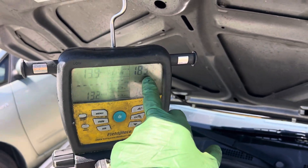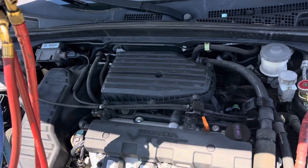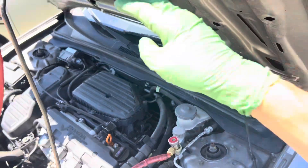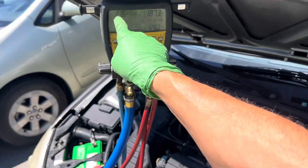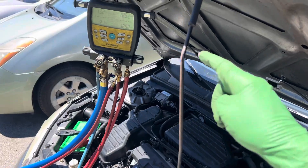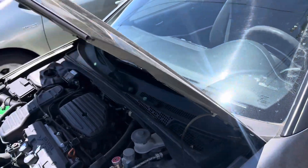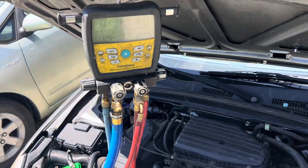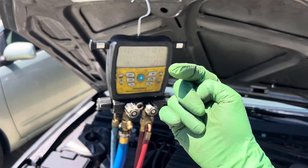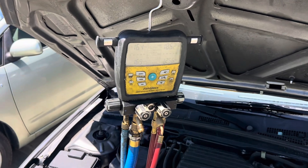It's hotter now but still too restrictive. You can see our high side went up to 180, and the low side went up a little bit because now we've got this hot air mixed with ambient air going over the fresh air intake, putting a higher load over the evaporator. That made our low side go higher and our high side definitely went higher because of this. All right, through these sporadic last six videos I hope you gained some knowledge. There's no editing, no retaking — whatever mistake I made stays in. Don't be afraid to ask questions. See you guys later.